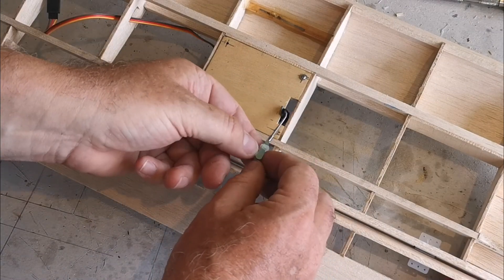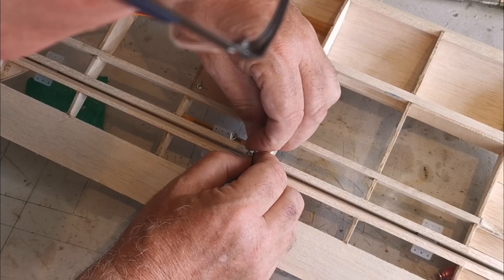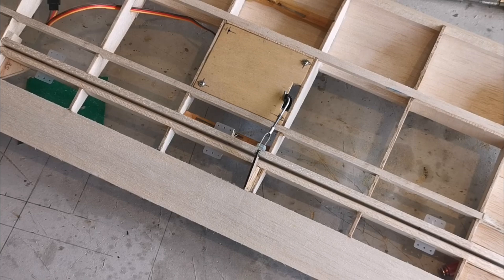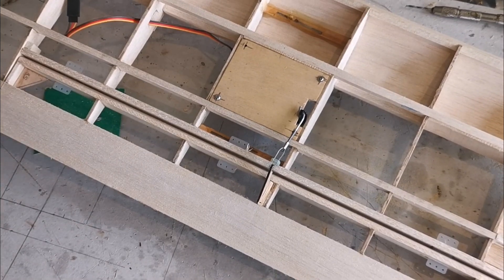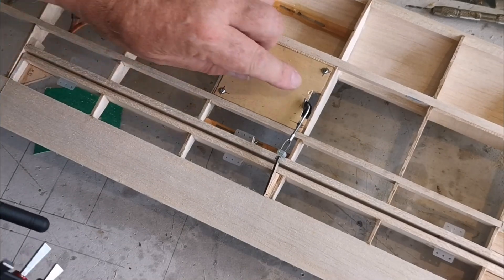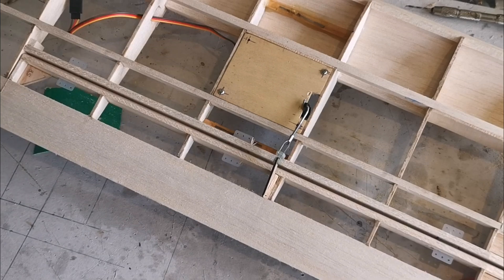I need to pull this out and see if I've managed to do so. Yeah, it's going to go. There we go - that's a nice sounding click. Move the little rubber up there. Slight adjustment needed there perhaps - that's easily done. We'll try it out. Slop free! And see it's hitting there a little bit, but I can remove some of the inside of this clevis - it's not needed. There we go. Happy with that - there's a job done.